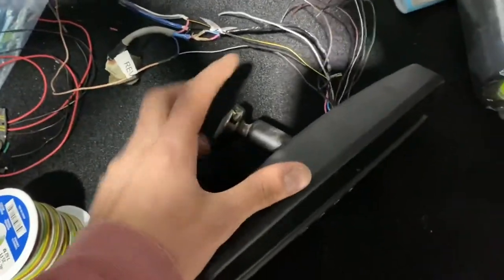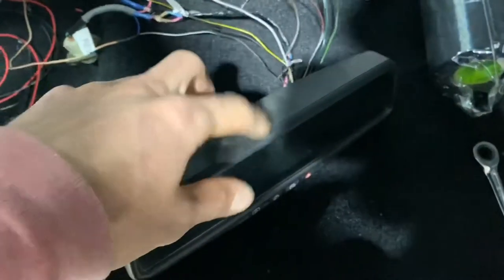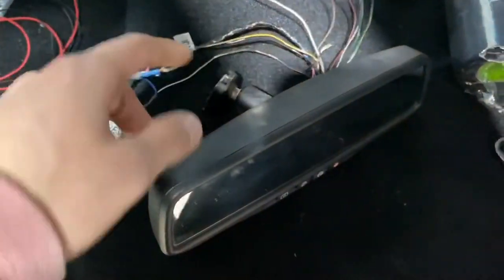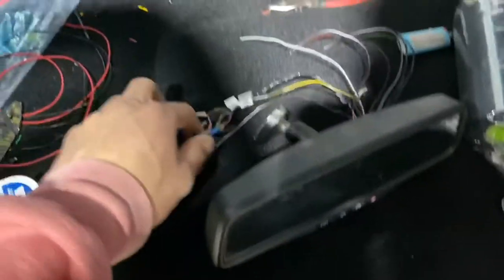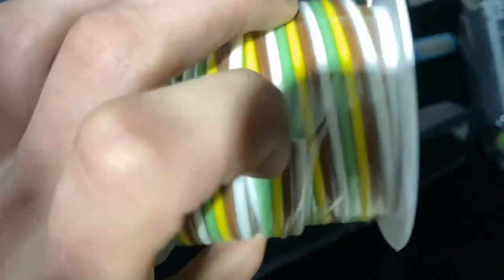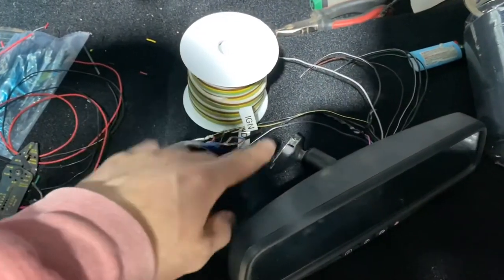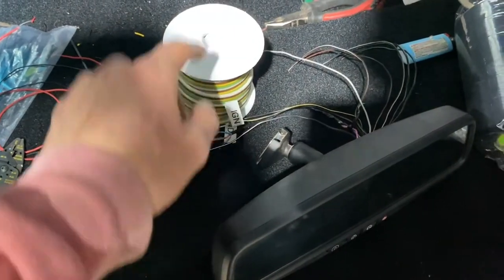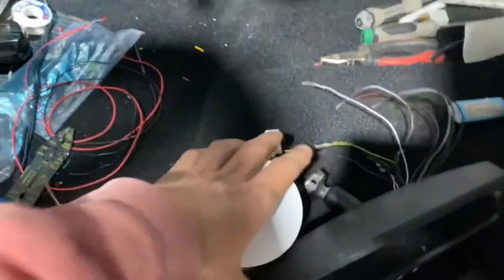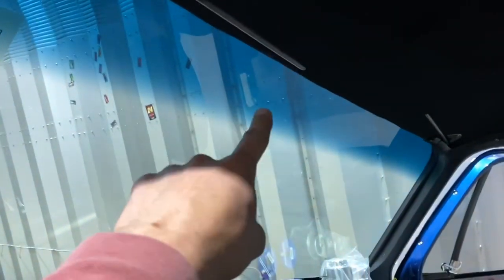I figured out the wiring — there are three wires that go directly from camera to mirror, and then you have a power and a ground: ignition source and ground going to both camera and mirror. You also need a reverse signal that hooks into your reverse lights, so that when you put it in reverse, it triggers the mirror to turn on and the camera to activate. I had it all wired up just to test it and it does work. I'm going to run four-wire trailer wiring from front to back — three of those will be for the camera signal, and one more will be my ignition signal. The ground and reverse signal will already be at the back in the rear lights harness. I'll run it up under the dash for the ignition signal, then run three wires up the A-pillar and across to where the mirror will be mounted.